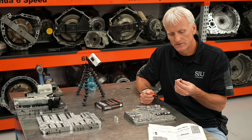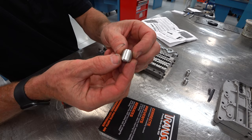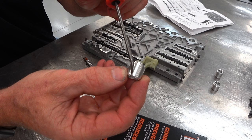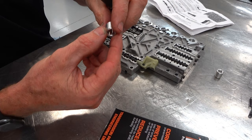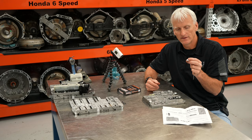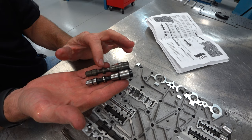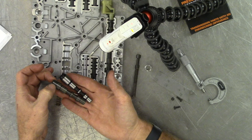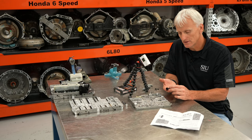The other fixes in the kit are the bushings. On the upper valve body half we've got the 2-3 and the 3-4 overlap bushing — these bushings are all different. TransGo identifies them by putting a dimple on them: one dimple indicates the 2-3 overlap valve, and two dimples represents the 3-4 overlap valve. The 1-2/4-5 has no dimple and goes in the lower valve body. After measuring the valve lands with a micrometer, there's no difference in diameter — the only difference is the valve land on the steel TransGo valve is twice as long as the OE valve, so it rides on a previously unused portion of the bore to re-establish its seal.